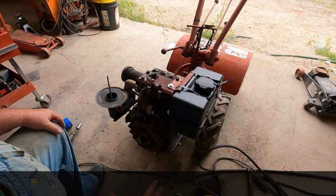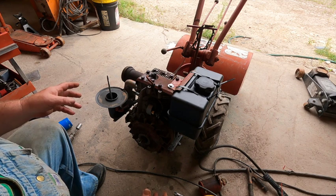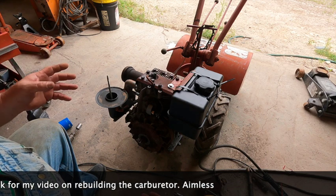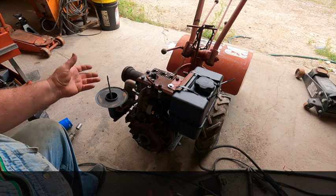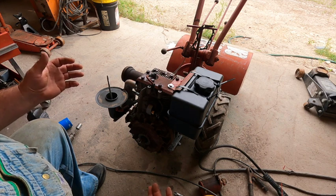There you have it! The carburetor needs to be gone through and cleaned up - it was sitting with gas in it, and modern-day gasoline is absolute garbage. That is why these old carbureted machines are always having something done to them. In 2007 they started running ethanol, and the ethanol in the gasoline evaporates out because it's a ventilated system. Once it evaporates, your system is stuck with garbage. It doesn't happen as much in modern cars because they're usually sealed systems. Thanks for watching - please hit the like button and share the video, and remember: if you love life and learning new things, goaimless.com.